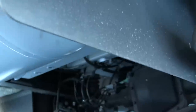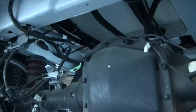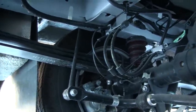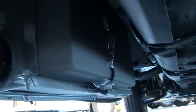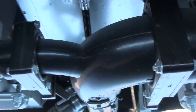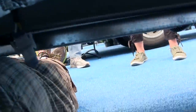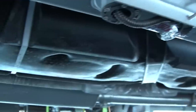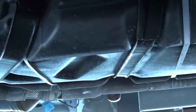Now going under the coach — it's tight under there. I'm showing the bolted steel that holds up the rear storage, a very large propane tank, and the rear differential. No water lines visible underneath. There are three leaves in that rear spring — that's a heavy-duty suspension; in our own van we actually added a third leaf to improve the ride. The black tank is driver's side midship, and the gray tank is sort of behind it — both square-shaped. Those tanks are not insulated or heated, which is worth noting for cold weather camping.